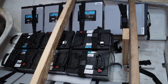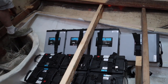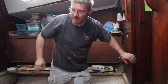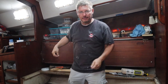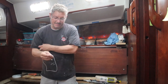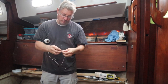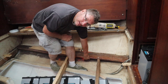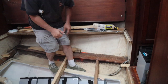So we had to take out a couple of batteries and move where they're going to be in order to install these floor joists. Floor joists ran across the tank and were kind of supported by the tank. But as you can see where we cut the floor out along the sides, here and over there, there's no support. The floor has been tabbed in with fiberglass here, but there's nothing underneath, and these joists need to go underneath here to hold that up.